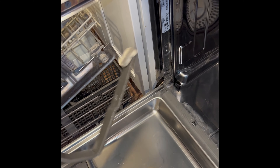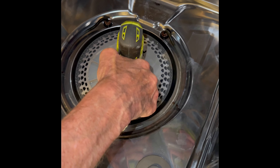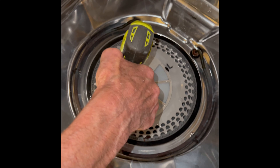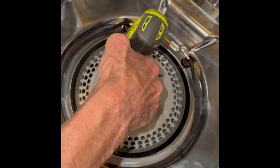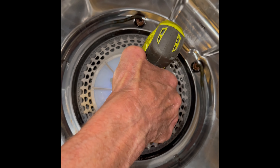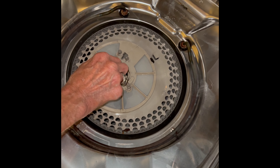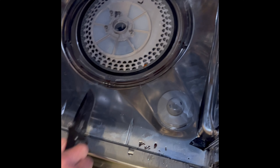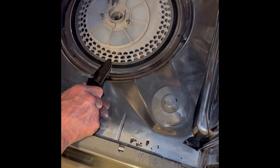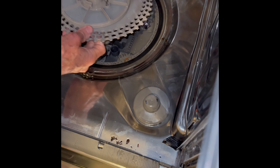This little piece fits in here. Now we're using a Torx 15 screw to unscrew — I believe it's five screws holding the filter assembly in position. We're going to get those screws all out and we're going to use something to pry up on this assembly. You could use a standard head screwdriver, or I'm just using my knife here to pry up, and we're going to take that to get it out of the way.